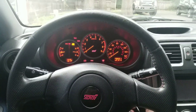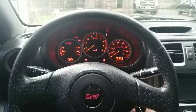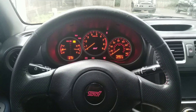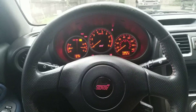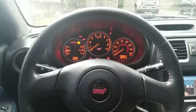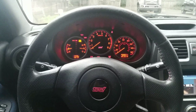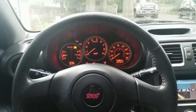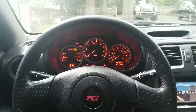Here we go. You hear that? That's kind of a telltale sign that one of the cylinders is a little bit low on compression — the uneven cranking. If you take your foot off the gas pedal when you're cranking it, it will start up. But other than that, the car runs and drives great. I am worried that compression is a little low on Cylinder 4.